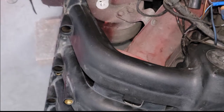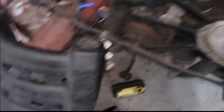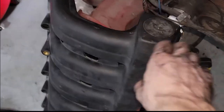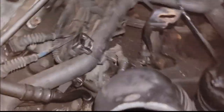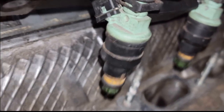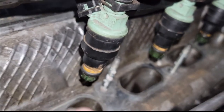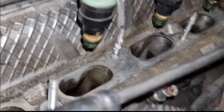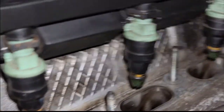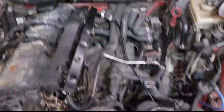Cleaned up the manifold. I might put some black polish and finish cleaning it up more, but I want to get the car running first. I do have my powder coating set up, but actually this is plastic so we'll figure that out later. I have all the fuel injectors in - that's a pain in the ass. There are two clips. Hopefully you can see the silver one and then the black rusted-looking one - tight squeeze, but they're on. So I just need to tighten up the in and return lines, throw the manifold on, start plugging stuff up, and throw all new vacuum lines on.